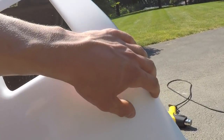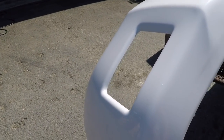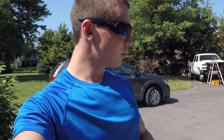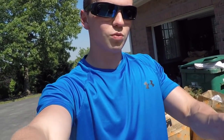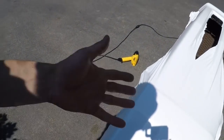This area is what I was most concerned about — I thought it was going to be wrinkle city going all the way through. But pulling it up and down and heating it came out pretty good. I'll show you exactly how I'm doing it on that side. Basically, you need two people: one person holds one end, another holds the other end pulling it tight. Then one person runs to the middle, peels off the backing that protects the adhesive, and then both pull away from each other, drop it down, and tuck it down and in.